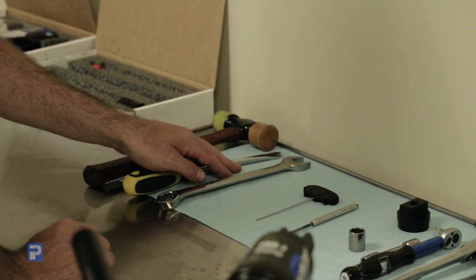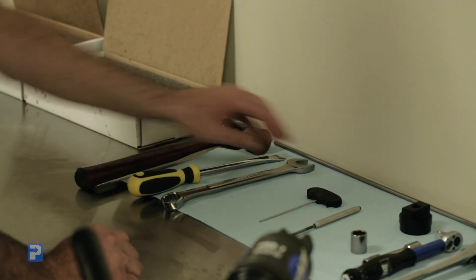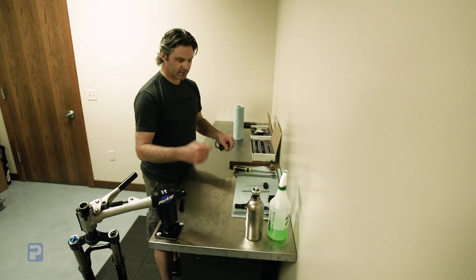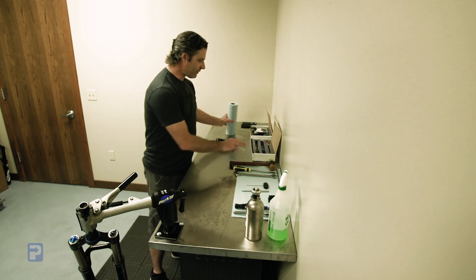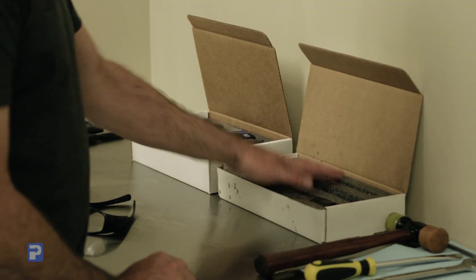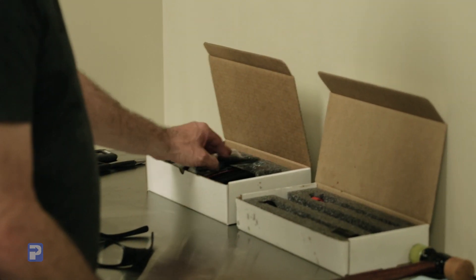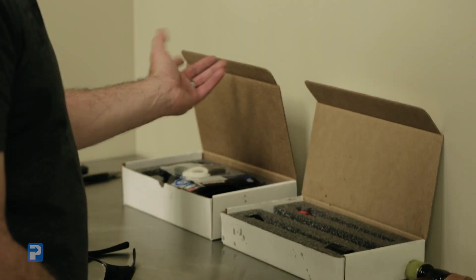One or either you can use. We prefer the tire lever for prying out seals. We've also got a little tap hammer and a rod for helping get rags down the lower legs for cleaning. Over here we have our ACS fork kit for this fork, and we also have a complete do-it-yourself lower leg service kit — both of these available from PUSH.